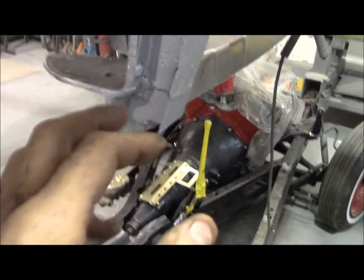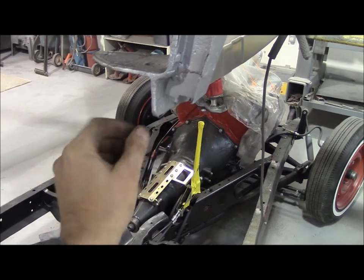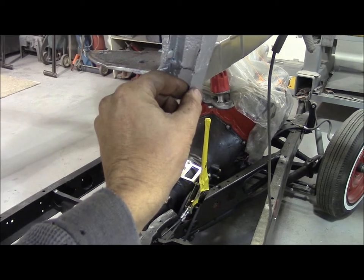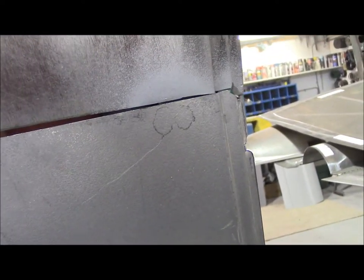We're back here. As you can see, I put a little piece in here — this is what was rotten. It kind of comes down and attaches here. Now somebody was asking me — I've had some guys ask me a few times — do you just leave it bare metal in behind when you do that kind of work? Because obviously that piece is now covered up with the panel. When the panel goes on, it's pretty hard to get in there. Well, it looks like a silvery color right now, and that's a weld-through primer. I've also put it on this section where I'm not going to get back into.